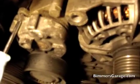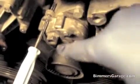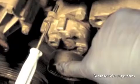You have to remove the idler pulley to get access to the bolt that's holding down the tensioner also. To remove the tension pulley I would need to remove two bolts — they're 13 millimeters. There's one up here and one underneath. I'm going to loosen this bolt first and then release the tension so this pulley will swing out a little bit and I can access the lower bolt on the back side, on the lower side underneath.